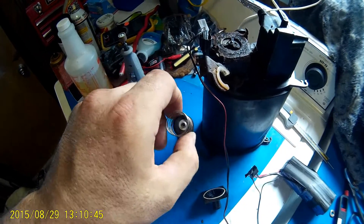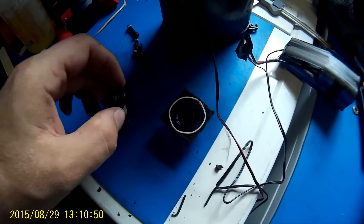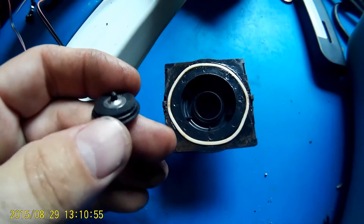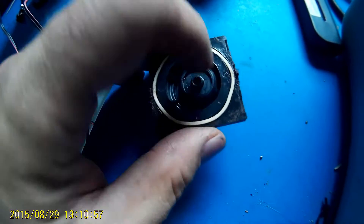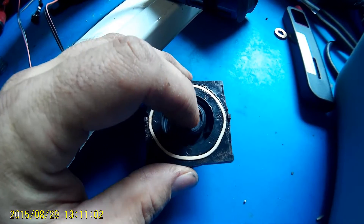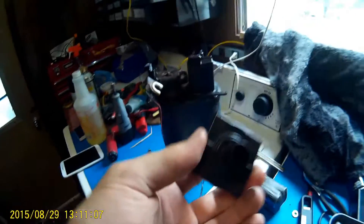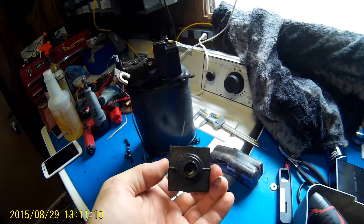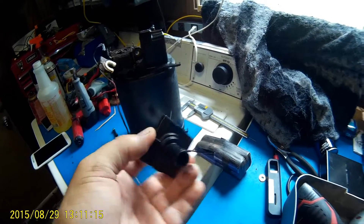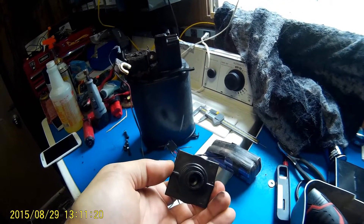It's hard to do, but all it's going to do is spring that valve closed, which springs this shut. So this is inside — get in the light — this will spring against that very tightly, so that when there's suction on this side it'll keep that closed, and vice versa if you try to blow on it, nothing will go through either.